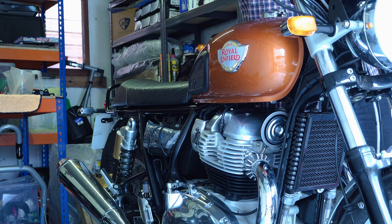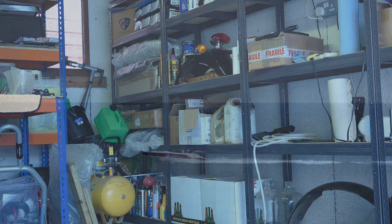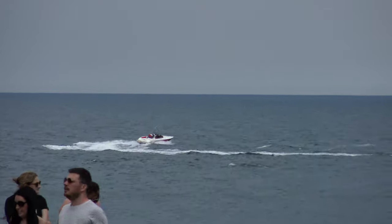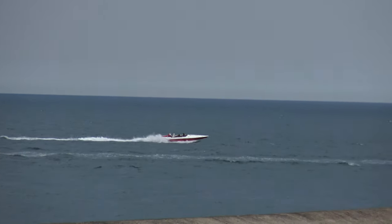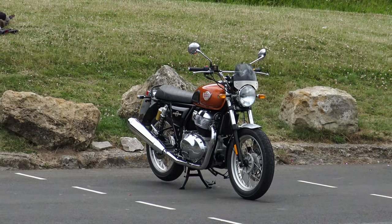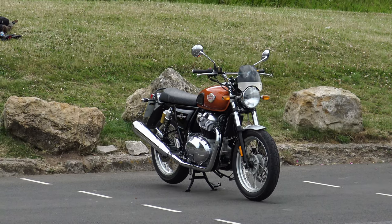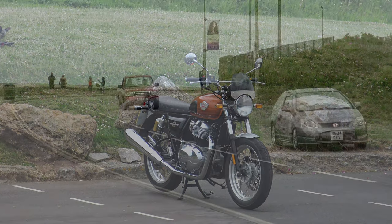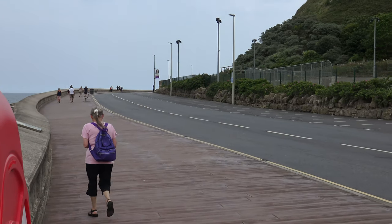There was an instant noticeable difference in the way the bike performed after adjusting the tappets — the valves were clearly restricting things, and there was a notable increase in power, though I hadn't noticed the gradual drop-off over the previous hundred miles or so. The bike is now just coming up to 500 miles. In the next video we'll be covering checking, cleaning, and lubing the chain, and the final video will cover the remainder of the service schedule. I'll leave links in the description for the materials I used. Thank you for watching — please leave a like, subscribe, ride safely, and I'll see you soon.